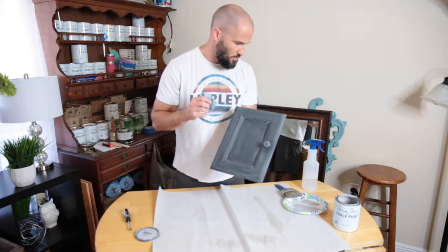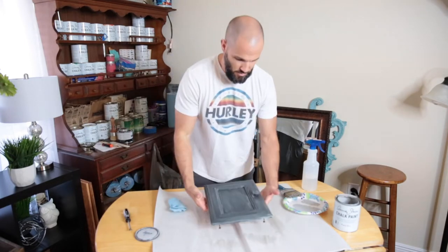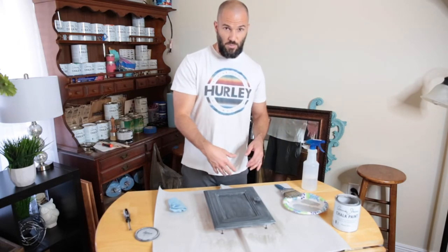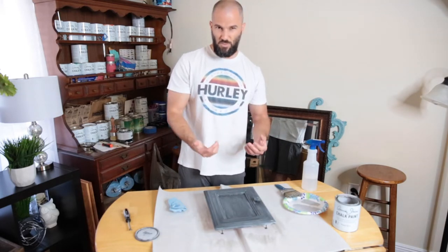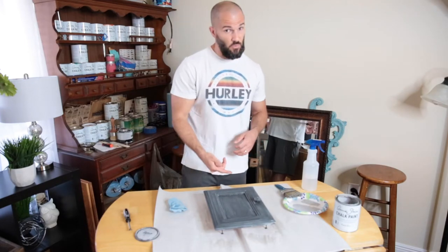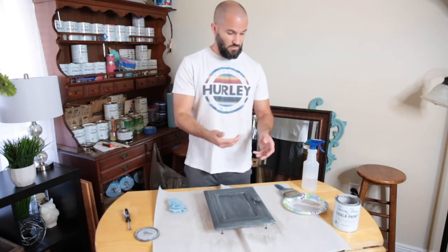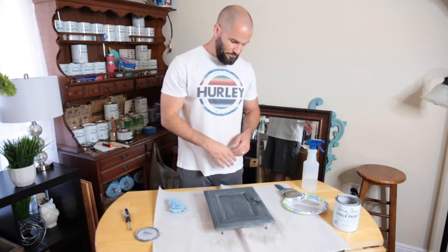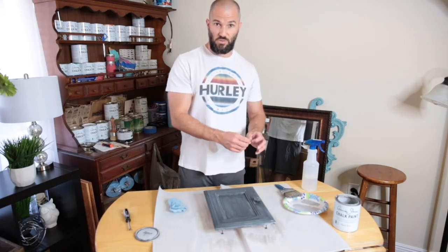The only trick to the spray bottle, and one thing I want to make sure I mention, if you spray onto paint, especially any stone paint, and you don't get that spot, there'll be wet spots in your paint. So you'll have spots, almost like grease spots when they creep up through paint sometimes. And then if you wax over that, those spots are still there. You're not waxing and making that spot go away. So you have to remove the wax, go back down, and even it back out again, because when spots hit, it darkens the paint, so it shows the wet spots.